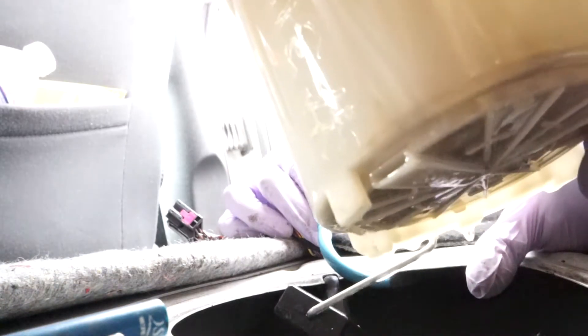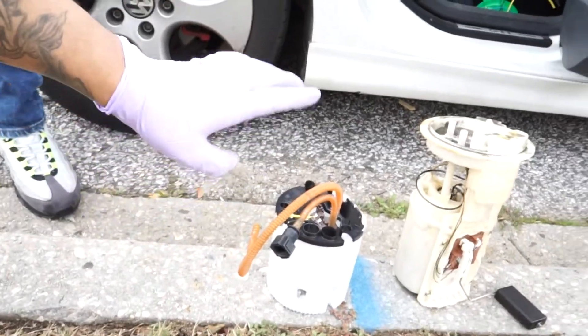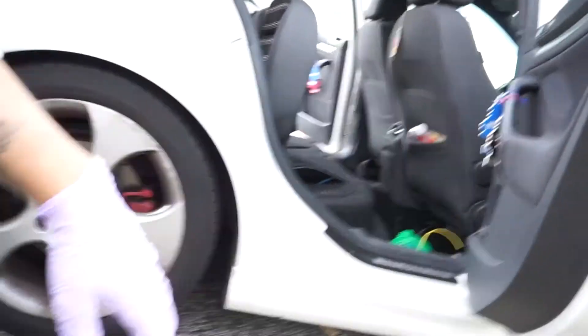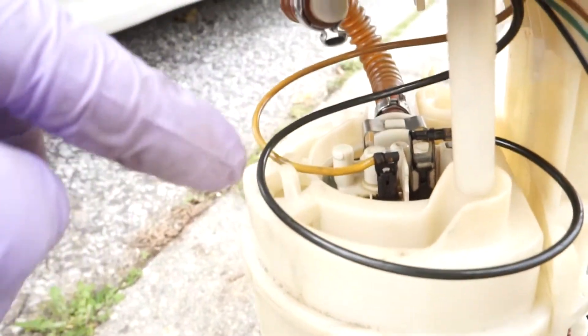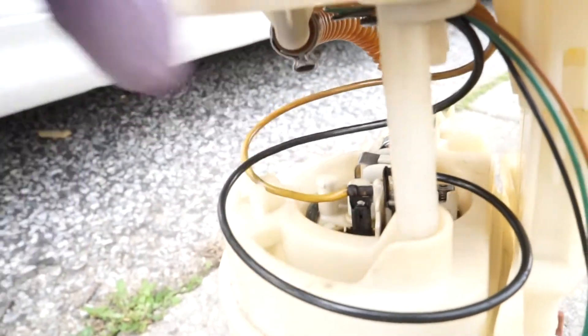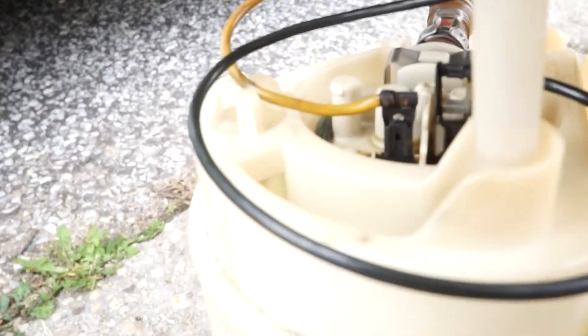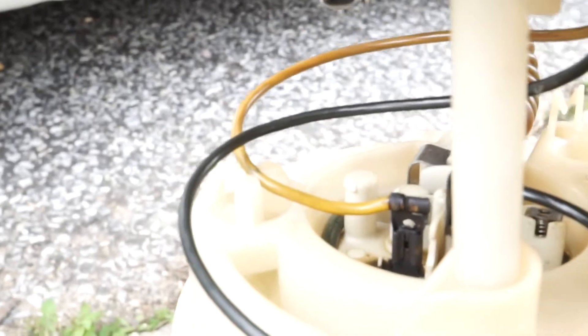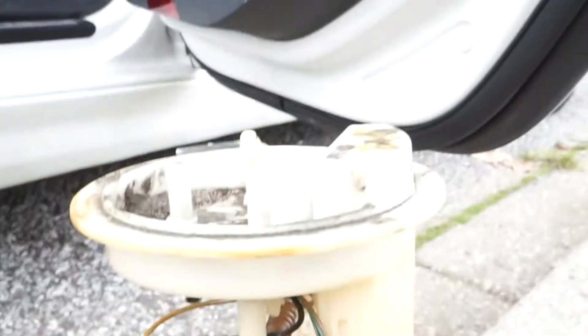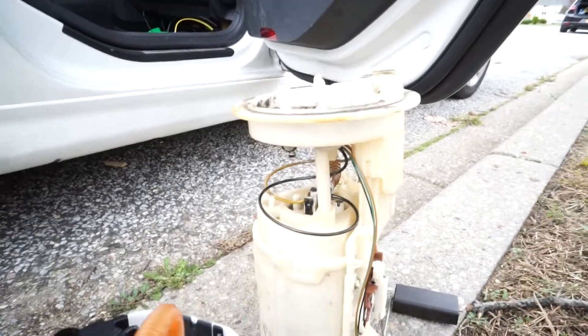And it's full of fuel. So we pretty much figured out the problem — now we actually have two problems, because we can't use this R32 fuel pump on the car. We figured out what the issue was with his. If you notice down here, the connectors are getting blacked out because fuel is leaking up there. And if you notice down there — let me zoom in — this ring at the very bottom is popped up because it's cut.